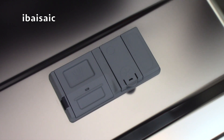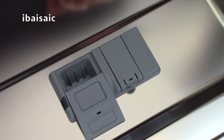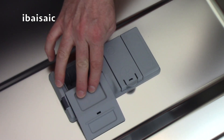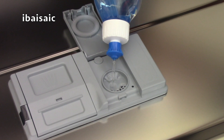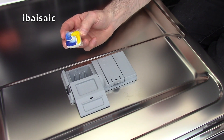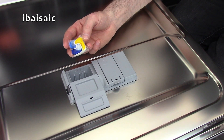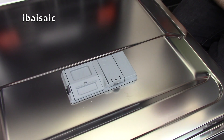Before I put a load of dirty crockery in, I'll show you the detergent and rinse aid dispenser located in the door. Press this button to open the detergent compartment — inside you can use tablets, powder detergent or liquid dishwasher detergent. Once you've got the tablet or detergent in, simply close it. For rinse aid, pour it in up to the maximum fill line. I would recommend using rinse aid even if you use combined tablets.